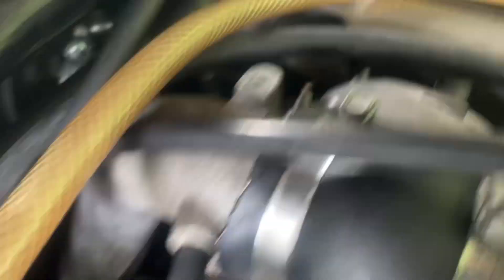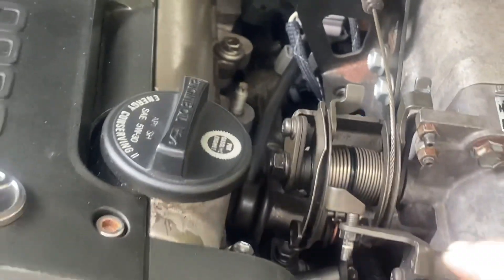It was really oily yesterday right out the back of the turbo, and you can see it under here where the down pipe is. It's a little wet in there. Ever since I put in the injectors that are supposed to be in this car — 550s — it runs so much better. I tried to get on it for the first time and it felt really fast, and I wanted to wait till I get stuff on camera — the first full throttle on the twin turbo setup.